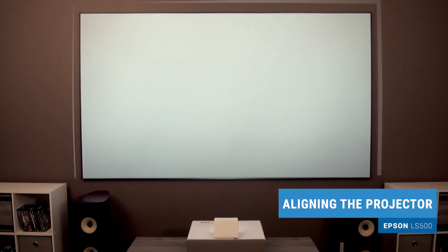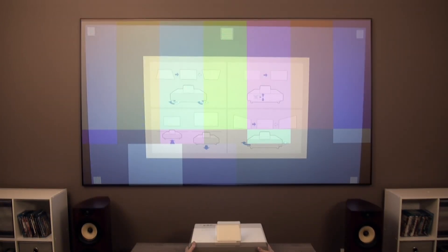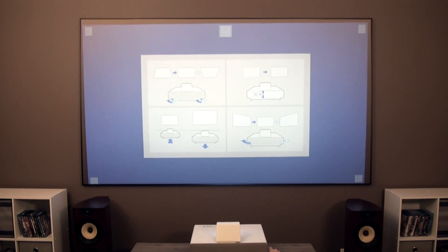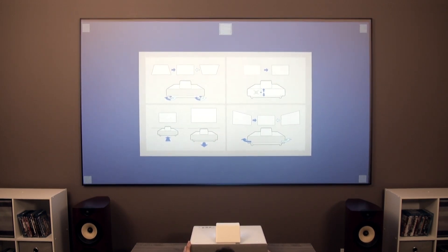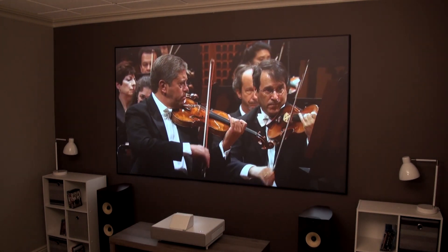The last step is getting the projector set up and aligned. Epson provides both geometric keystone correction, as most UST projectors do, and border adjustments to block out any minor overspill from bowing, but it's best to do this using only the physical movement of the projector if you can. Hopefully you're starting out with a level projector surface and a level screen, so it's first a matter of repositioning the projector at the right distance for the proper image size. Once that's done, you can twist the projector left and right to zero in on the height of the left and right top corners. Finally, use the two adjustments at the front of the projector to eliminate any remaining keystone and make the left and right edges of the image parallel to the screen border. A few rounds of this should hone the image in very nicely.